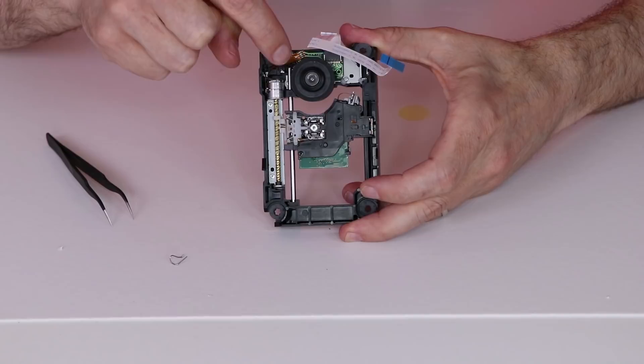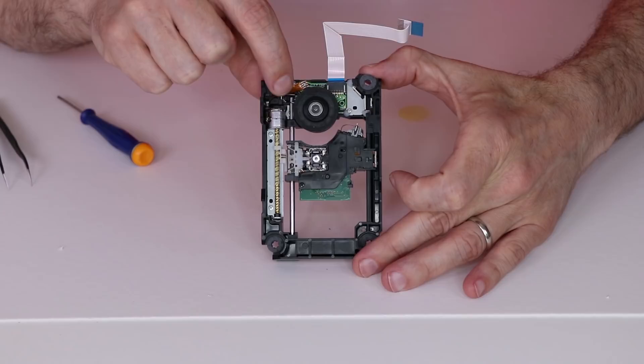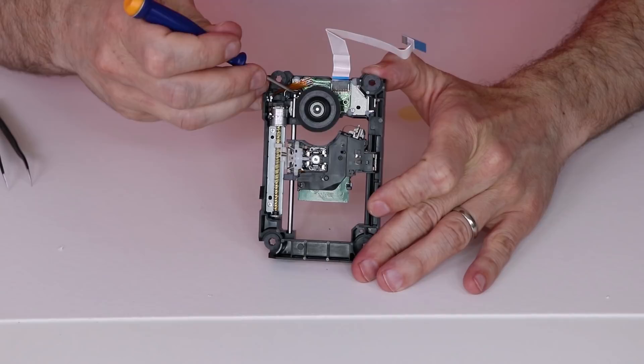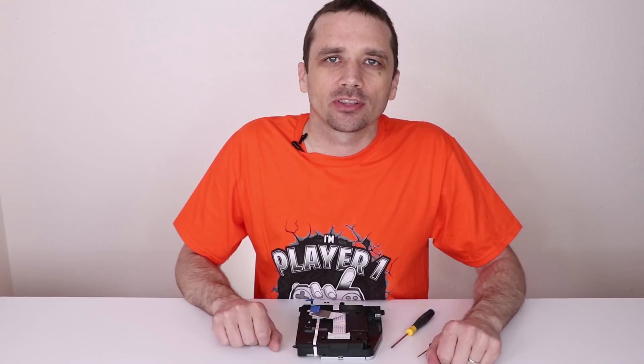That's what it should look like with the bar all the way back in. The tricky part can be getting this clip back in — make sure it's oriented correctly, then push it down into its groove. Put the back of the clip down first, then this straight piece will push under the clip — there's a little clip right here that needs to be pushed underneath. Once that clip is pushed underneath and fully installed, we are done replacing the laser on our PS4 Pro disk drive.